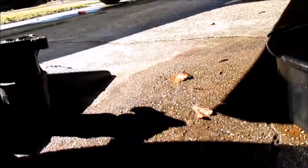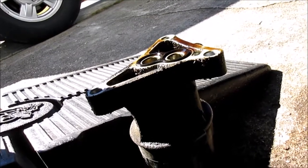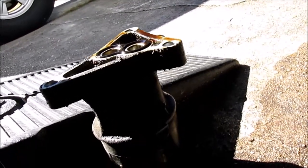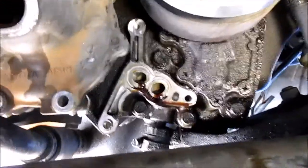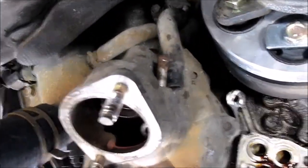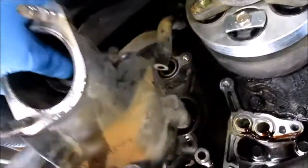The only other thing you have to do to get the water pump out is take off this oil filter bracket, which has three bolts and a little figure-eight shaped gasket — thankfully it stuck to the back of this one. I don't have another gasket. That's where it mounts, and you can see where the three bolt holes are in a delta pattern. The hose comes off that little nipple up there, and thank god that wasn't stuck. So now this comes right out.